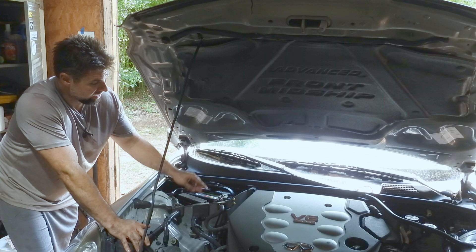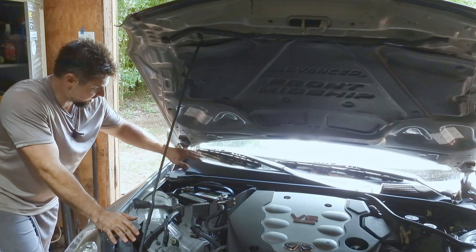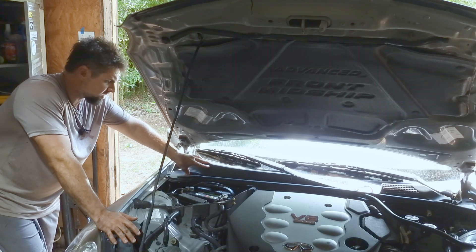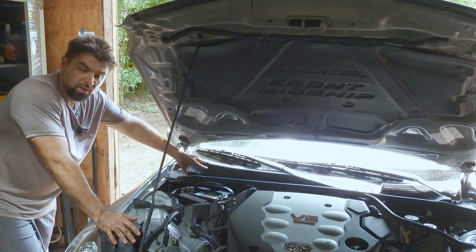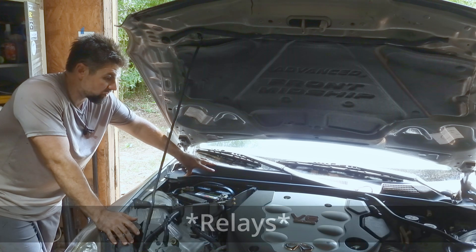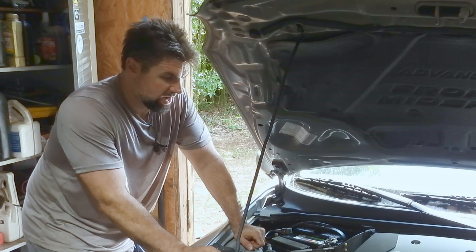My plan of attack is to test those two fuses. If they are good, we're going to check the relays. There are actually three relays, located under this plastic cowling in the IPDM, which is basically another fuse box. You can go in there and manually pull those fuses out. Despite what I've read online, they are actually replaceable fuses — they're not integrated into that module. Each relay has a little tab where you can get a small screwdriver and push it down and pull the relay out.